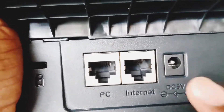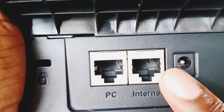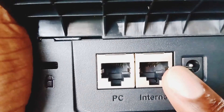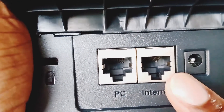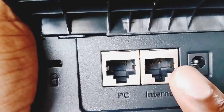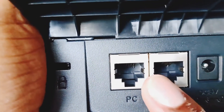Basically what this allows you to do is to come in here with a cable from your switch or router — coming from your internet or network — to supply the phone with its internet, and also power if you have a Power over Ethernet switch or router, and a Power over Ethernet compatible phone, which this one is. Your internet comes in here like any other IP phone, and then the pass-through part is this, where it says PC.